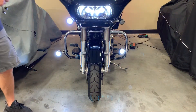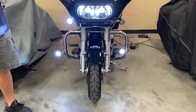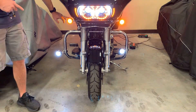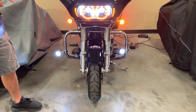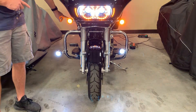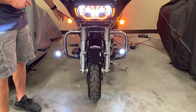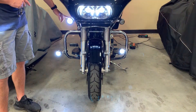The Federal Motor Vehicle Safety Standards cover two things. When you have an integrated DRL and turn signal, the DRL must turn off for the complete cycle of the turn signal, which this is not doing. You also cannot have a forward-facing white light on a motor vehicle that flashes. So this is a good way that you can get stopped by an officer because you are in violation of two Federal Motor Vehicle Safety Standards.